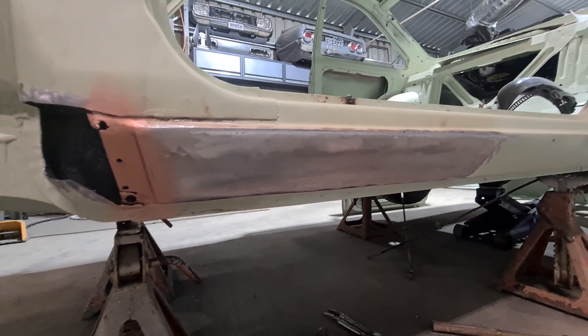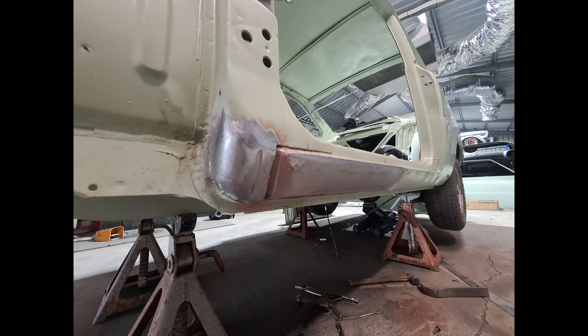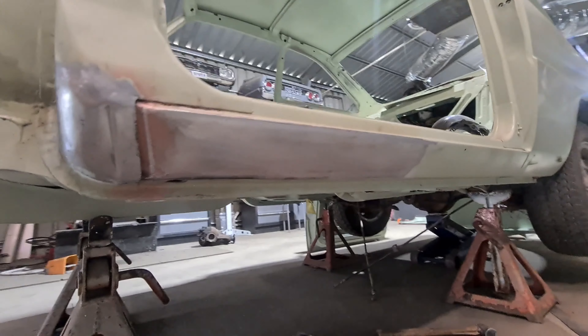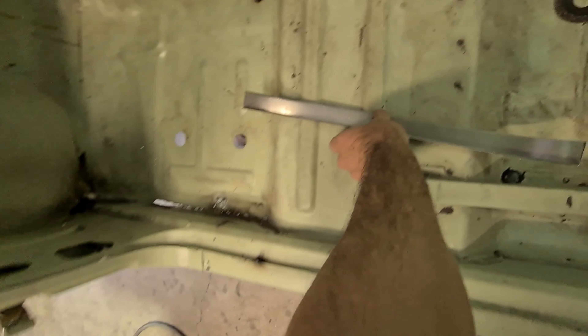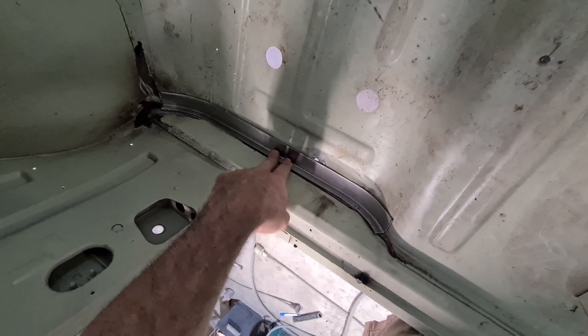That section of the sill is replaced — it's got this little piece to put in now. Seals are all repaired, so moving on to something else, probably the inner of this floor. Just a simple shrinker stretcher on a piece of normal 90 fold just to get the floor piece sorted.